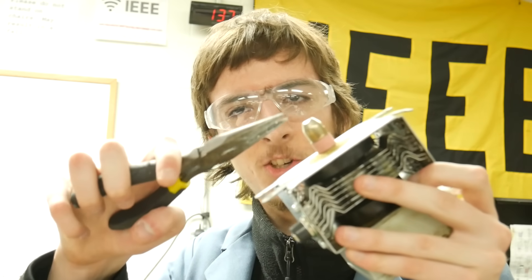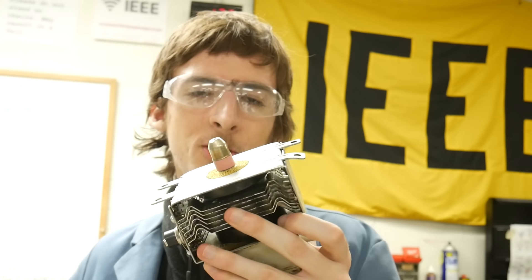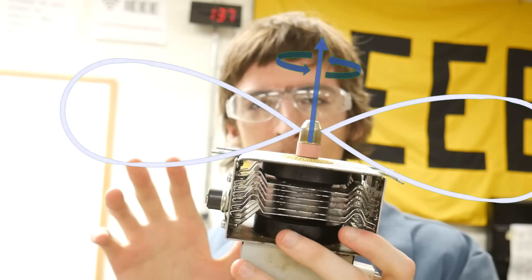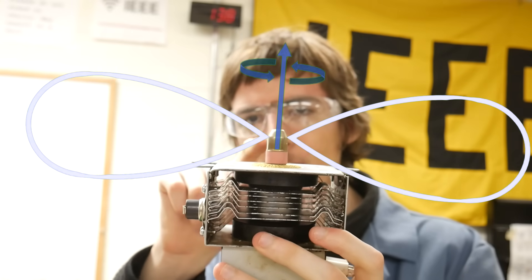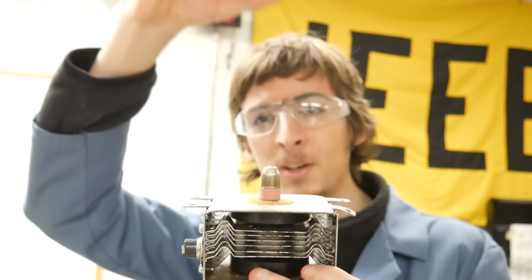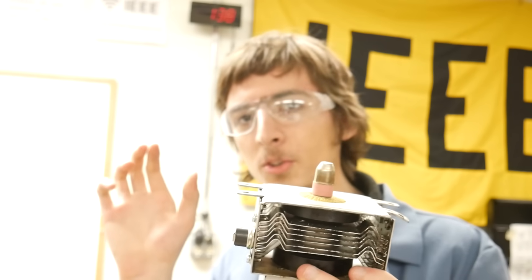There is a lot more we could say about this — in fact, we could be here all day. But if you're interested in learning more, I'll include some links and references in the description. Let's take a look back at the magnetron I have sitting on the table. This top piece here is the antenna for the magnetron. You may expect the waves to come straight out as if it was coming out of a gun, but that's not actually what it looks like. The output from the antenna looks something like this — these shapes that you see here are the primary lobes. This is where you can expect the greatest intensity, which means something directly in front of the magnetron would have almost no interaction with it.